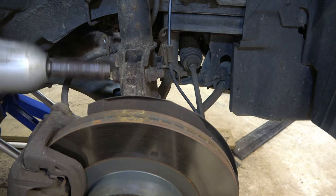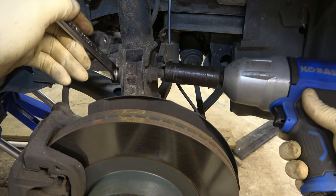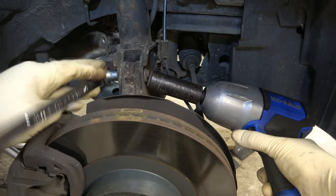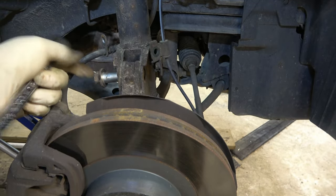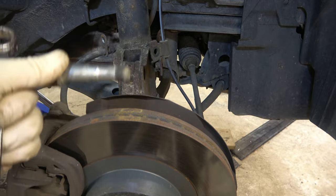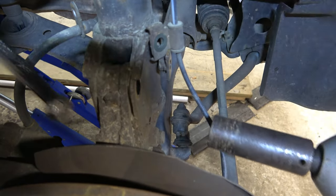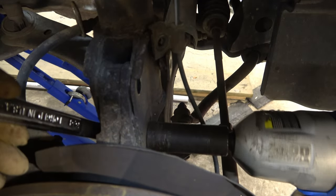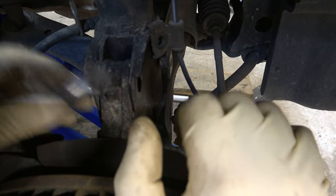You can't turn it from this side because you'll rotate the eccentric bolt. So what you want to do is hold this side with a 19mm wrench, and then this side you're going to remove the nut. You can see when it comes out — that's an eccentric bolt. See how it's kind of egg-shaped? That's how we adjust camber on Subaru. Do the same thing here with the bottom one. This bolt down here might be a little harder to take out, so just kind of wiggle it until it comes free.